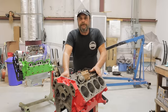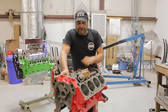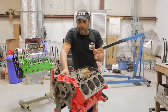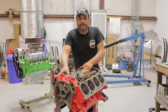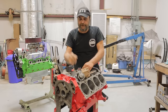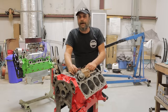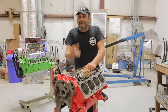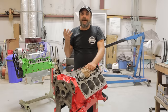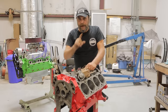The perfect example is that small block Chevy in John's Caddy. There was one scene where we pulled into the gas station, I jumped under the hood, grabbed the distributor, gave it a tug, and we went back out again. He said it runs much better — you could feel the way the car responded to the throttle. I was power timing it. I can tell by the tone of the engine's exhaust, how it responds to throttle, and if I hear an audible ping under load.